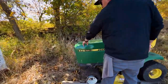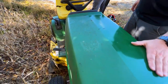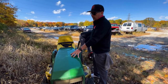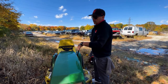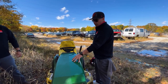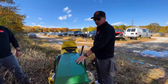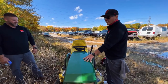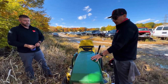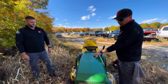You can see in the paint how bad it is. I'll tape this off and use a product we get a lot of questions about, swirl remover, for removing light imperfections and swirls. A common misconception is that for any scratches, you just use swirl remover and it's going to remove them. There is some truth to it, but we always recommend swirl remover for light imperfections from your wash mitt. When you start getting into heavy scratching, if it looks like a Wolverine's been on there, you're going to need a three-step and actually cut it and then polish it. Not necessarily all three steps, but a variation, a one to a three or a two to a three. This is going to show you what swirl remover does do. It will remove light imperfections in the paint from your wash mitt. It'll bring this paint back so much compared to what just the wax did.